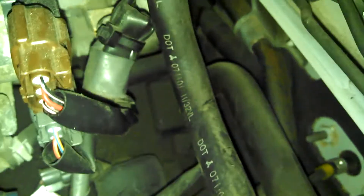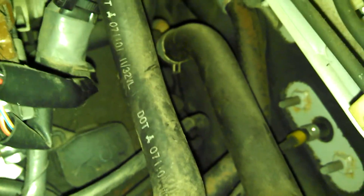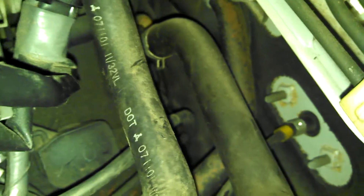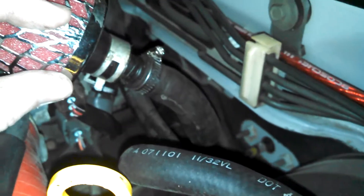The only thing that stopped me from driving it for a couple of days — because I didn't think about it beforehand — is there's a crankcase breather back here. You can see it, this hose here coming up and out. That also went into the intake, so rather than trying to put another nipple on, you can move it around; it's loose.